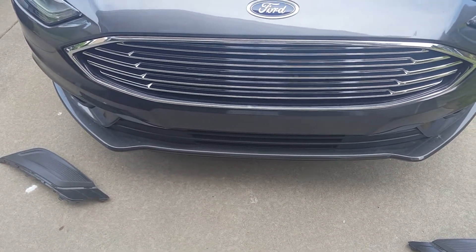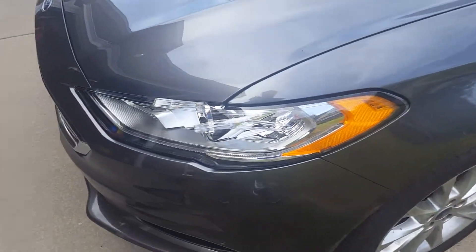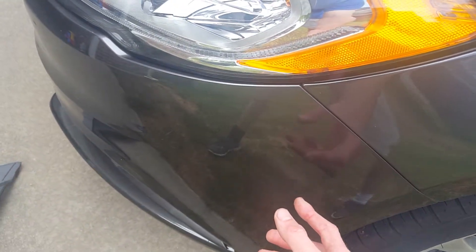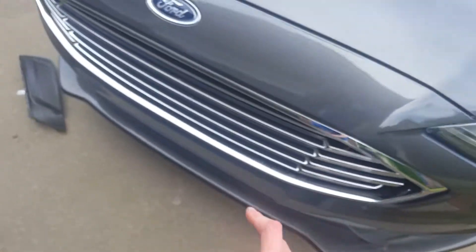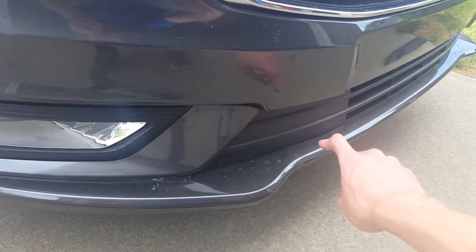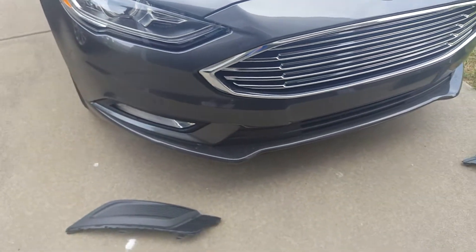People are asking where does it plug into — the main wiring harness is right here, right behind the bumper. When you take it off you can see it runs to the bumper. All you have to do is disconnect the one wiring harness — there are two, but it's the smaller one you want to disconnect and remove from the bumper. I'll add the part numbers in the description. Make sure all the wiring matches up with your sensors, active grille shutters, and the fog light connector.